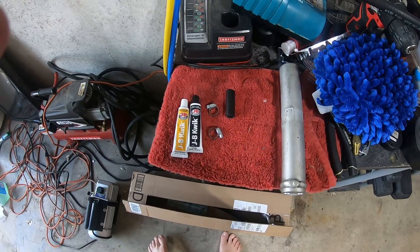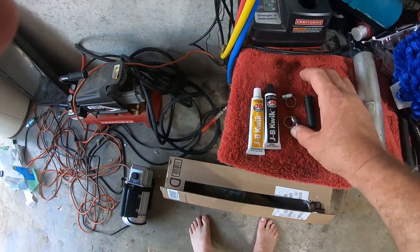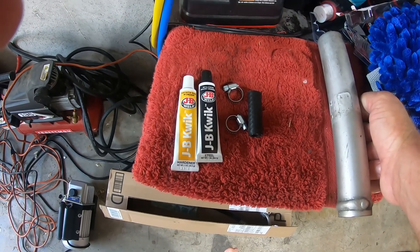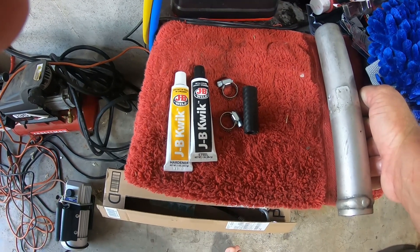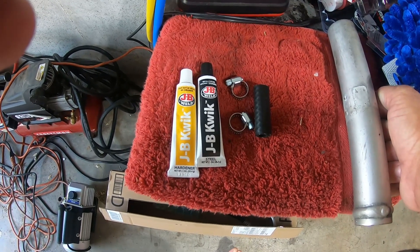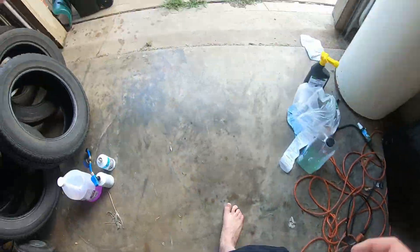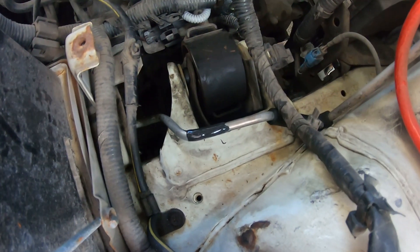It's the next day and I'm working on the AC fiasco. These are the repair products I'm going to try before buying the whole new liquid line — which isn't expensive, they found one for around $70, but it's going to be a pain to replace because it literally wraps the entire engine bay from the condenser all the way to the H-block on the passenger side. We're going to try JB Weld, then a piece of hose over the welded point with two clamps side by side to press down on it. The weld is already on there.